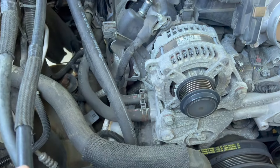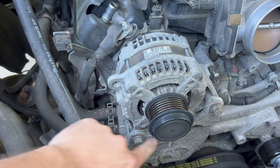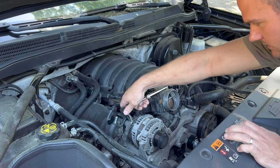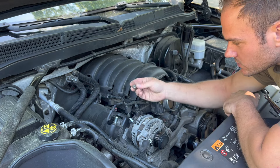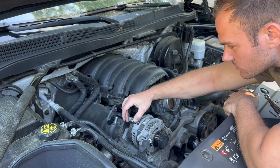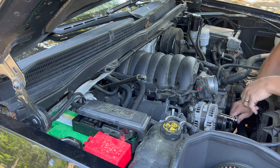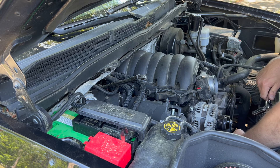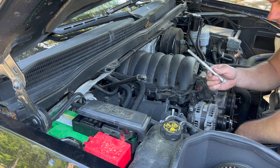Next I'm going to remove the alternator — it's got the power connection right there and then two bolts. These bolts go into the head so I need to take them out to get the heads off. This is a 13 millimeter. Wherever I can, I put the bolts or nuts back to where they're supposed to be — that way you have the least amount of nuts and screws laying around.